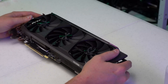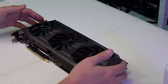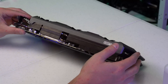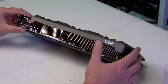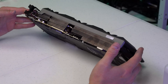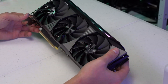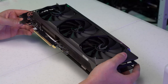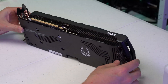On the front of the card you want to be a little more precise — it is a little tricky. The 3090 was easier to do; for some reason it only has two-millimeter pads on the back. But looking at this from the outside, the pads are all in the right places. They are a little bit wider dimension-wise than the stock pads. I like to overshoot rather than undershoot. I did mess up a couple times with the screws — I've been doing 3090s non-stop and this is slightly different.